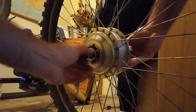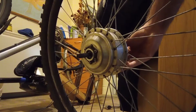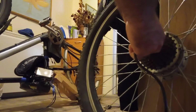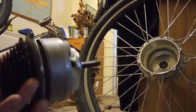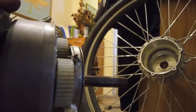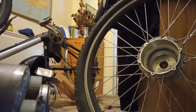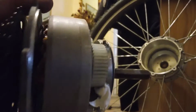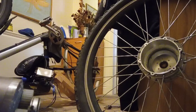So the plan is to weld the clutch together, but that involves a lot of electricity. And the motor just slides straight out. As you can see, it's in perfect condition, but it has a lot of expensive, valuable electronics in there, and I don't want massive surges of electric energy running through something that has such delicate electronics near it. So instead, I'm going to remove this and work on it independently.